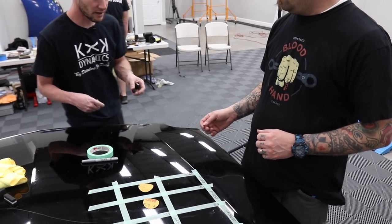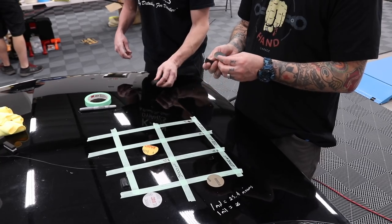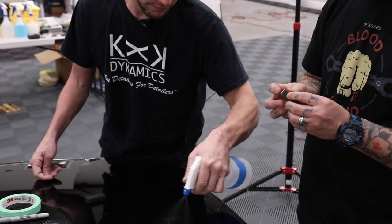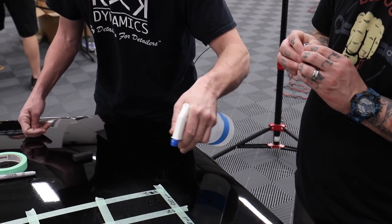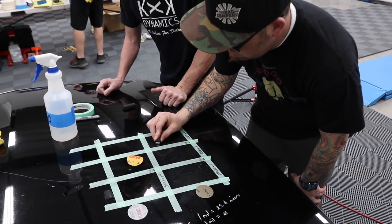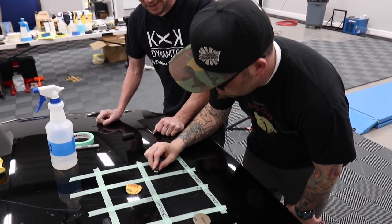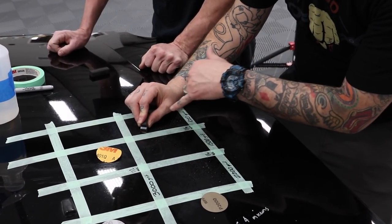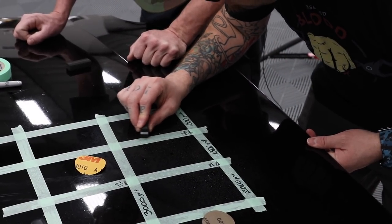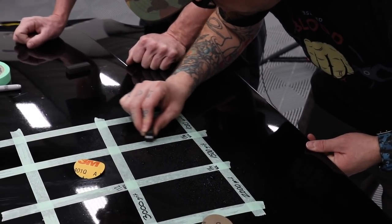Okay, here are the sanding sticks. Go ahead and use this one for that. We'll get you some water. So this is 1,000 grit. Any procedural difference with 1,000 grit than 3,000 grit? Just know that it's a lower number, so keep that in the back of your head. We'll just do a small section. Typically, 1,000 grit is not meant for OEM paint on a scratch. I wouldn't recommend that.